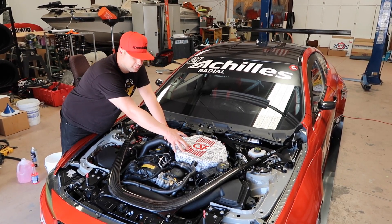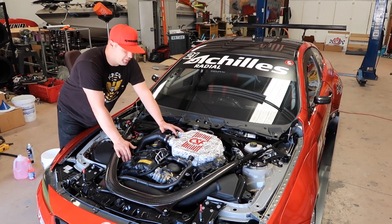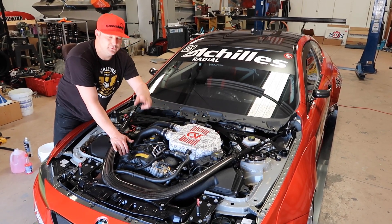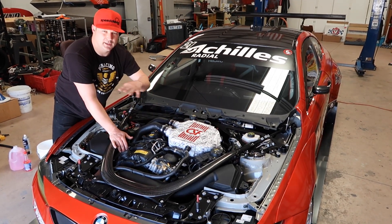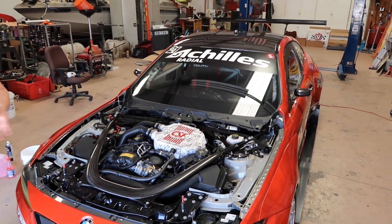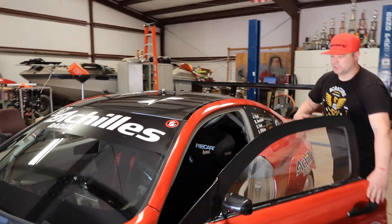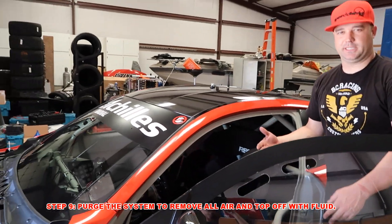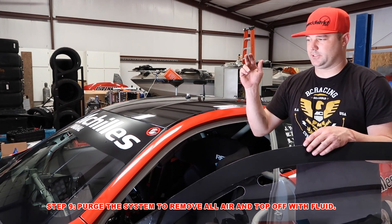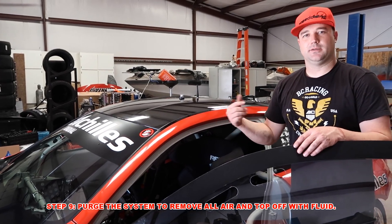What's really important about this system is that you purge it. Just like how we eliminated the remaining fluid that was in the line, we have to activate the pump again, and what that'll do is it'll flush the whole system. Activating the pump will work out any air bubbles in the system. So what we're going to do is we're going to go into the driver compartment. You're going to put it on an auxiliary mode and you're going to push and hold the gas pedal for about 15 seconds, and what that does is it activates the electric pump that'll actually start to force fluid through that cooler, which will allow us to just top off the system and make sure it's good to go.